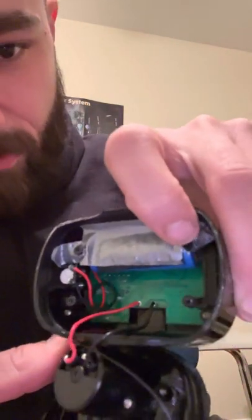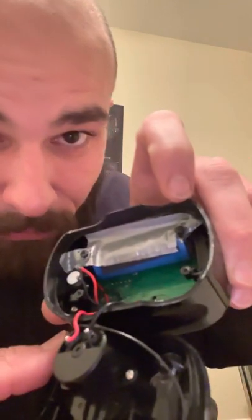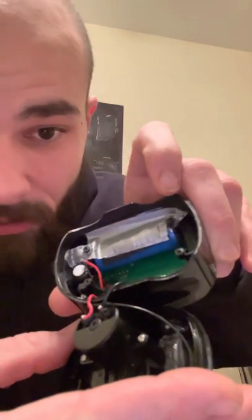I used duct tape — just cut around it and pushed it down a bit — and it works fine. I also took two small screwdrivers and bent that other side of the contact sort of like a boomerang, so that when you push the battery down it's always touching. Put one screwdriver in at the bottom, then the other, and very carefully bend it. Then I put the battery in place with duct tape. The gasket didn't slide down perfectly so I can't close it completely as before, but there is a rubber seal on it so it should work — and it still runs like a champ.